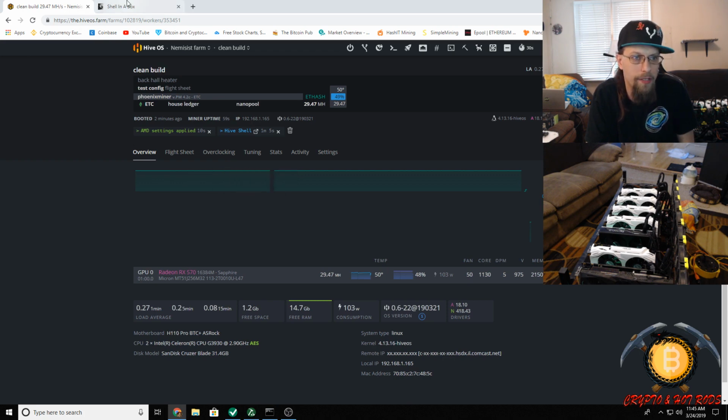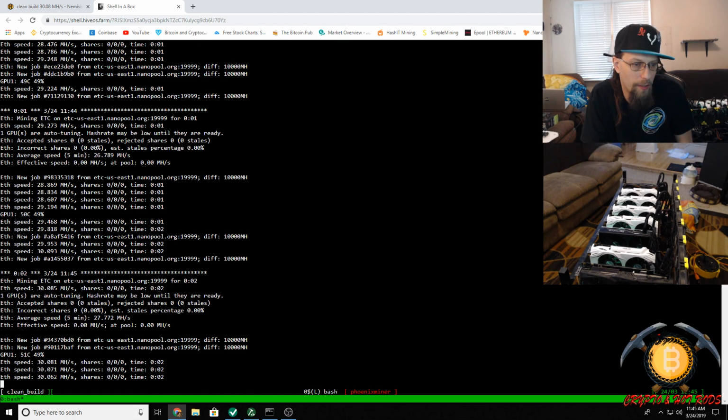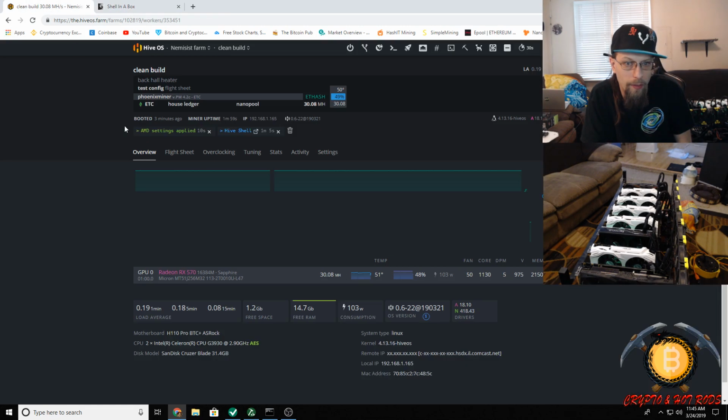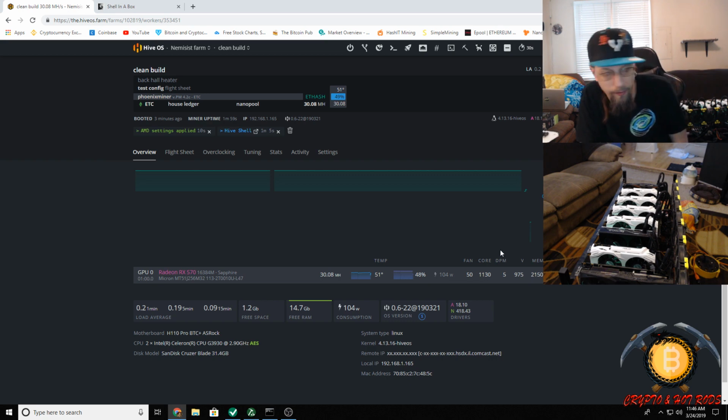Wow. Let's see if she sits here for a few seconds, if I get any more. Yo, she broke 30. Broke 30. Oh, wow. We got 30. Yeah, buddy. So 30 mega hash on Ethereum Classic with the core at 1130, core voltage at 975 with the mem at 2150. Damn son, where'd you find that?